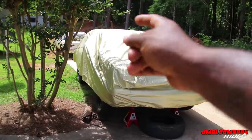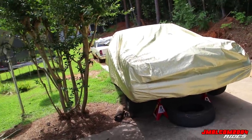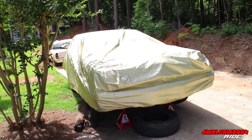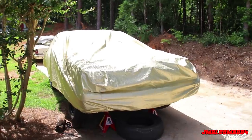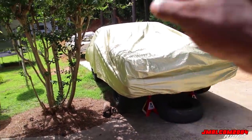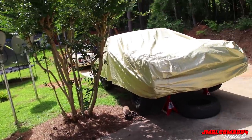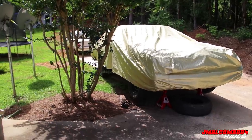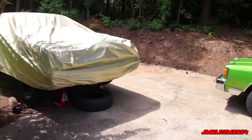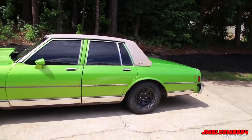It's just back when GM, they used to put it way back there instead of up here. So I really could take it off and just run a straight line. So if all else fails, that's what I do. Or I got a coupler. I got a barbed coupler, 3/8, that I can just put in between it and put clamps on it and problem solved. So that ain't a big problem. So I'm gonna get up on there and do that, cause I don't need no more of the expensive gas getting wasted.